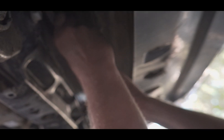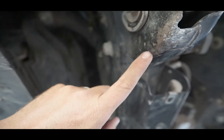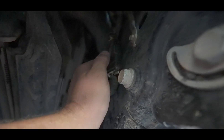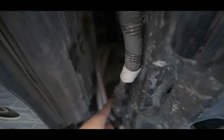Find the holes they came out of, slide the clip back in, figure out how it goes — click. Find the hole for the other one. So remember, our wires used to go right through here, and this is evidence of the rock that I hit. Wires now go over the frame, under the steering rack, under the harness right here, down to the plug, and over to the power wires for the steering rack.